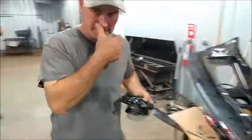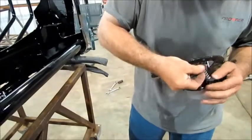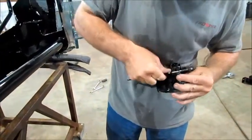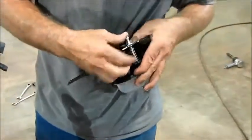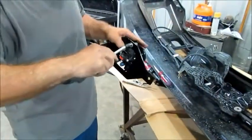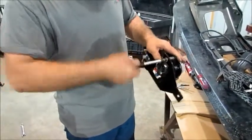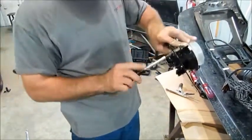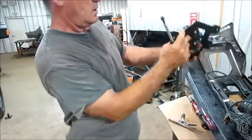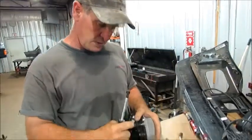We're going to get a quarter-inch washer. We're going to put our spring back in there just like it was. Put a washer there so our bolt won't go through the little hole. Then you're going to screw that down with the nut driver — same way it was in your other factory housing. Get it about level in there. You don't want to compress that spring all the way though — stop before you do.